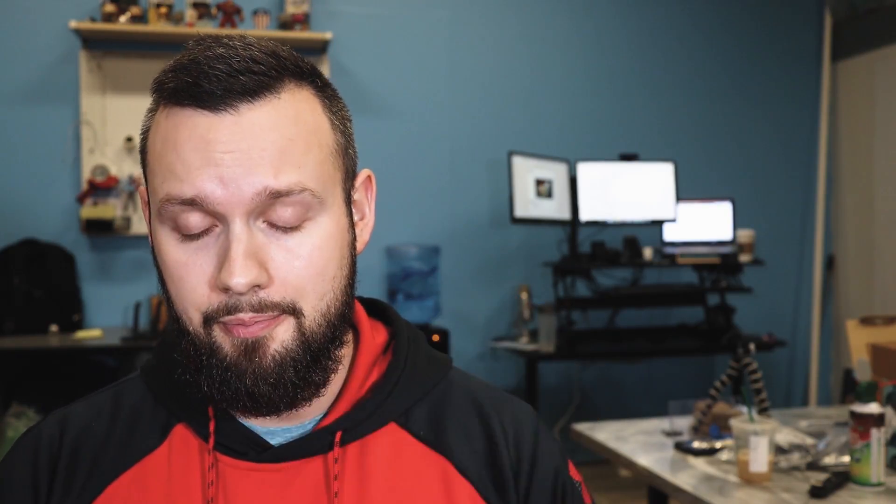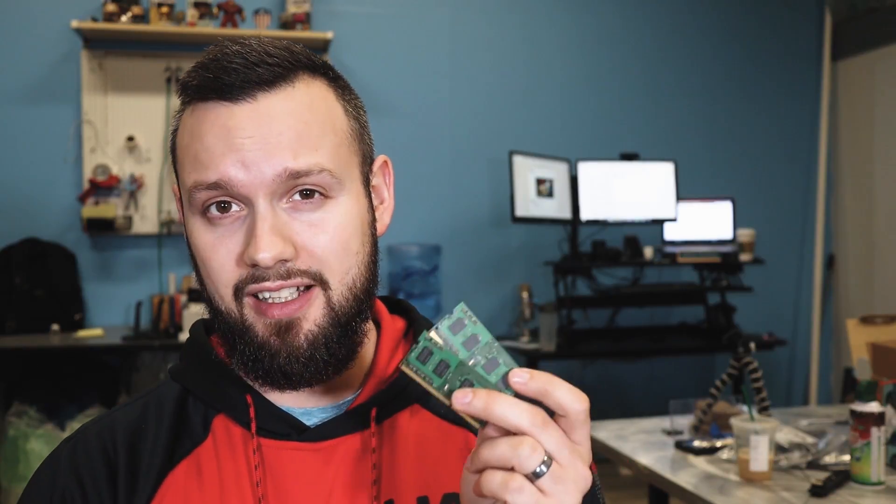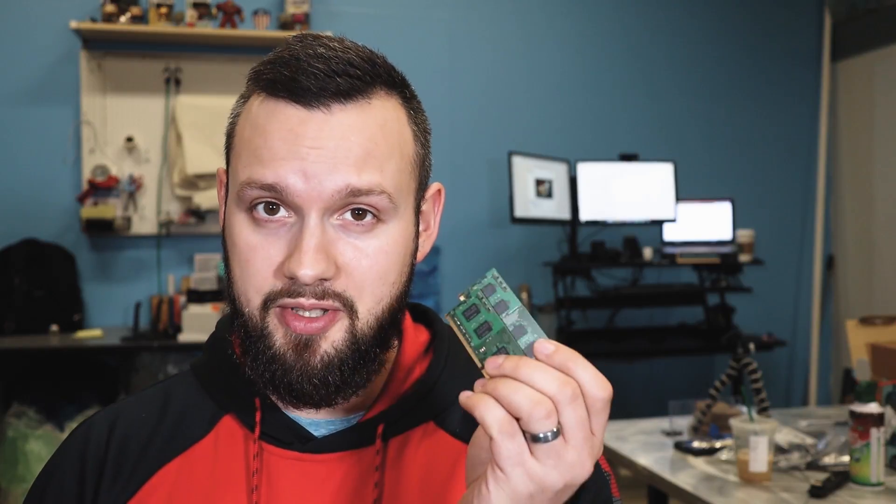You're only going to need a few things: one is a tiny screwdriver, and of course you're going to need your RAM. The MacBook Pro has two RAM slots, so these are going to be eight gigabytes each — we are doing a 16 gigabyte total upgrade today. Specifically MacBook Pros of 2012 or older are what you want to focus on, because 2013s and newer have everything soldered down to the board, so you're not able to swap out the hard drive or the RAM. Check out the RAM I'm specifically using via the link below.